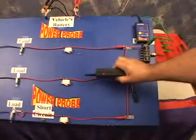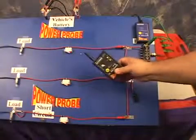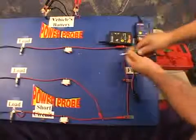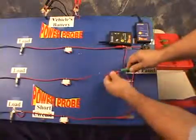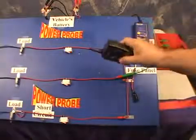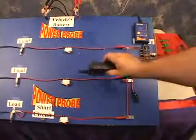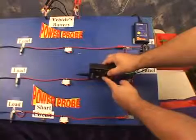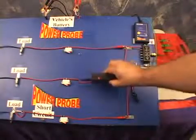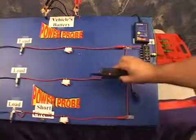Let's say you want to trace the middle circuit and not be confused by the other branches. You have to isolate the circuit you're tracing and connect the signal lead exclusively up to it. Take the smart receiver and lock in the sensitivity. The other branches are now free of signals, allowing you to stay on your circuit.